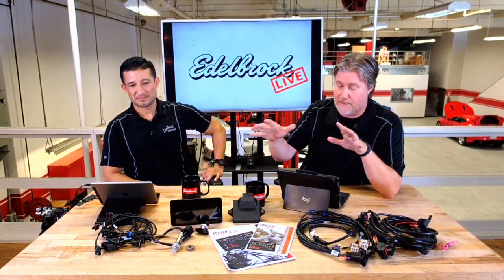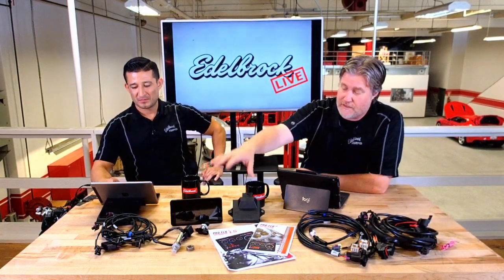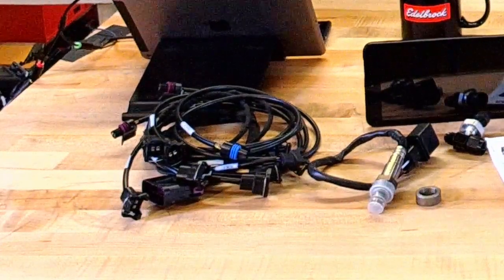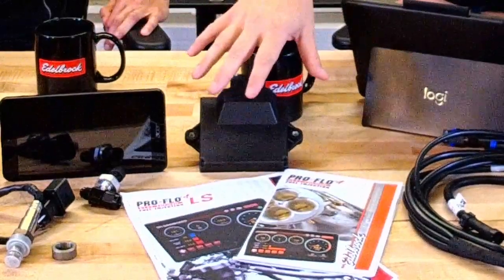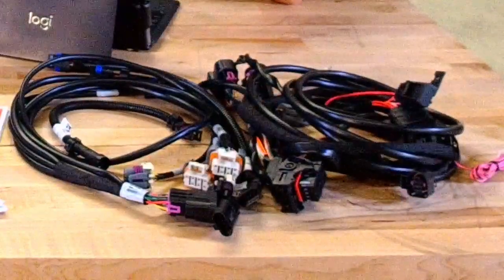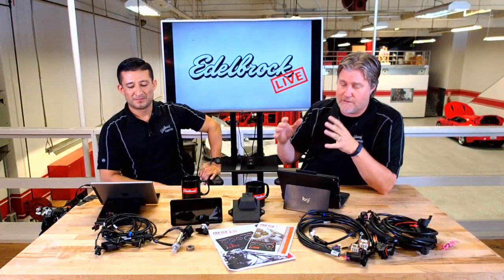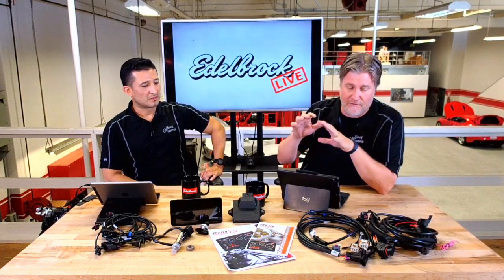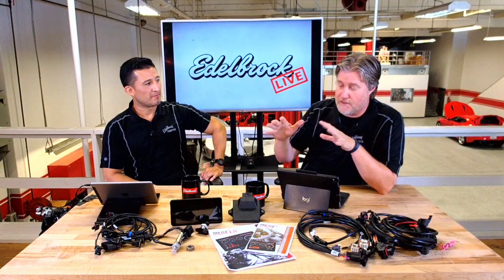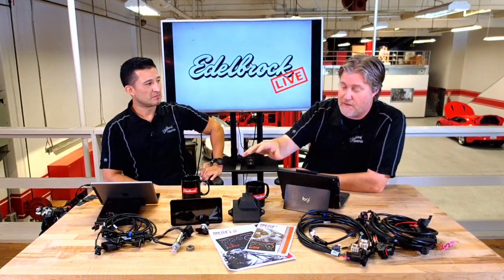What this is, it's a really compact style system that's got all the harness, the O2 sensor that you would need, and we sell it with and without the tablet. It has a water-resistant ECU, and what this allows you to do is take one of those junkyard motors, leave behind the OEM harness and ECU, and just use this. It all goes into the factory coils, injectors, and sensors, and then you use our eTuner software to set up and run the engine.